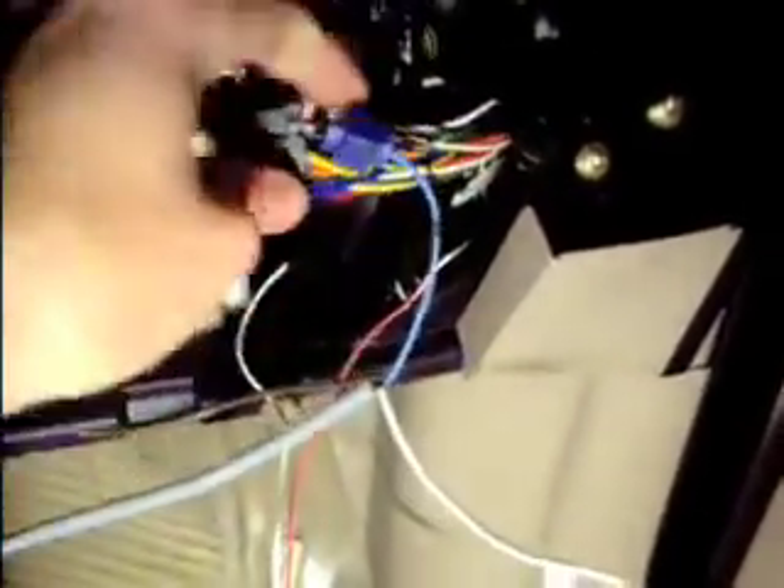I got the wire going over to the other side of the car where I've already tapped into the ready wire, so the DC-to-DC converter knows that the car is ready for high voltage. Here we have the splice into the green wire — you can see here, that's the ready switch.